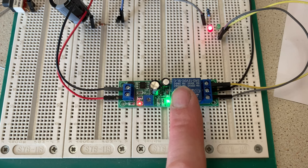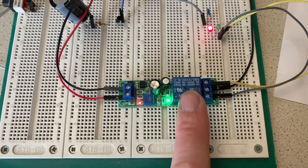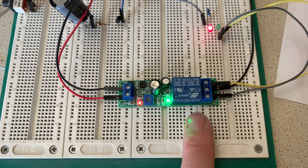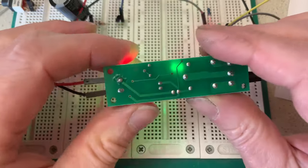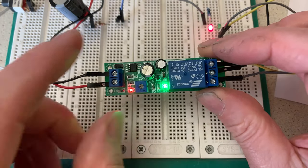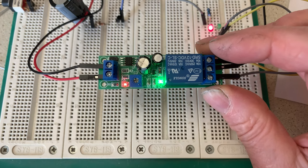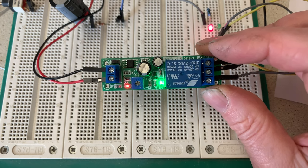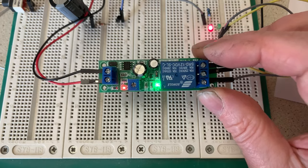I had a bag full of these. Five cost me £4.20 delivered to the UK from Banggood — it's really well built, based on a 555 timer, good quality relay, looks sound. If you turn it over it's basic but it works. A little extra wiring to do. I'm not going to put it in a case — just going to put it in a bit of clear heat shrink, just in case I need to alter the time settings, but I don't think I will. We'll set it to maximum, fit it and forget it. Down to the truck — let's splice into the wiring.